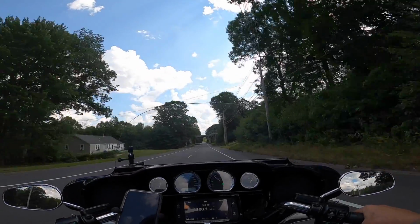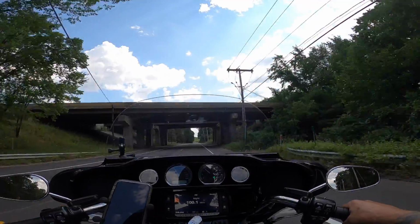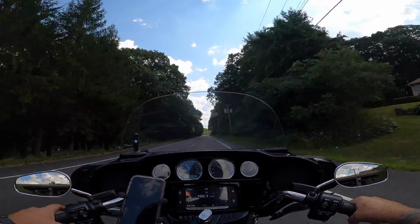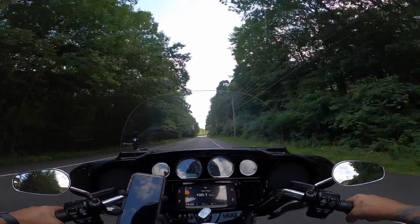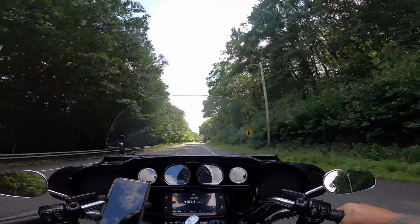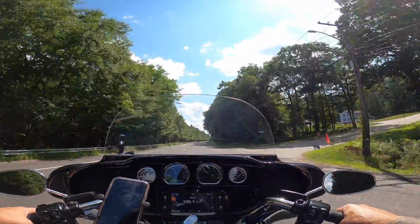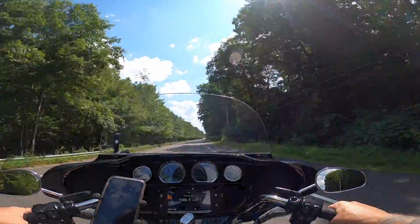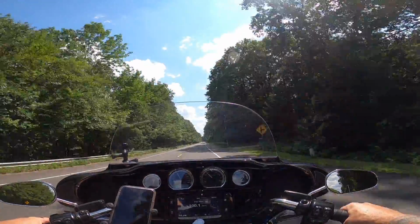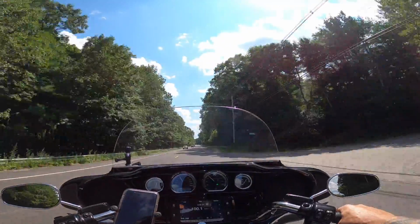And we'll be able to see exactly how the tunability is on them. I've got a dyno appointment at Rob's Dyno in Gardner, Mass on the 9th of October. So I'll be sure to tell him that those are installed, and while he's tuning the bike, we might make some adjustments to the little valve, I guess you'd call it a valve. The little flap that's hanging down. Raise it up a little bit and let it flow a little bit more, or push it down a little bit more to restrict it a bit. These are supposed to help a lot with the reversion on the exhaust.